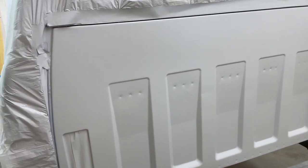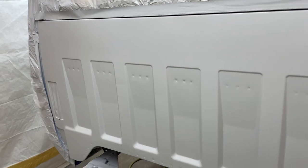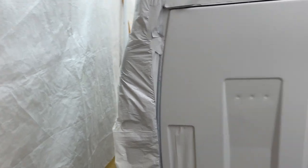Sealer sprayed down real smooth. Now moving to base coat — running the gun between 22 to 30 PSI. Checking the spray pattern: you want the droplets as small as possible. You can see some bigger droplets here — if they're too big you're going to have orange peel. Dialing the pressure in gets them real small. Let's get this base coat sprayed down.